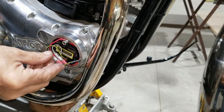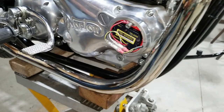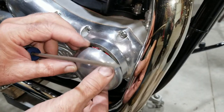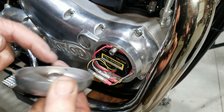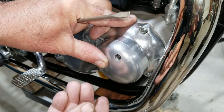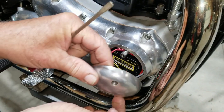Now at this point, we can put the cover on. And we have to switch out that plug down there too, where your pin was. Put this on. Yeah, this goes on a certain way. I leave these wires out so they touch the cover and the cover pushes them, so that way there's less vibration of wires bouncing around when it's running. This cover does have a little drain hole on it too, and that goes at the bottom.